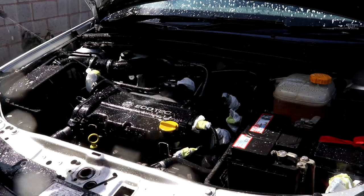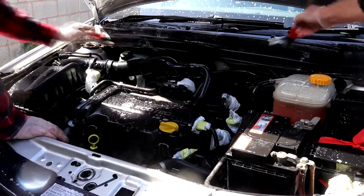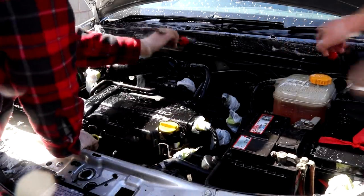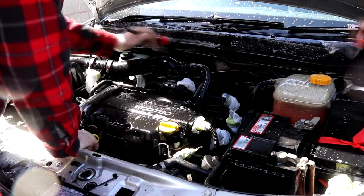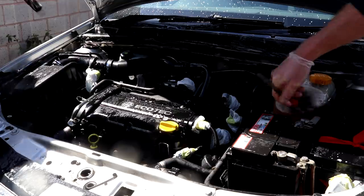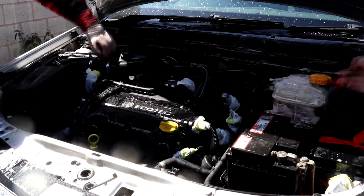When the bay has been thoroughly dosed, get stuck in there with all of your cleaning implements. We begin with those normal looking wheel brushes first, get into all of the top facing surfaces and rubbers, grommets, pipes, tubing, covers and seals, etc. Followed with utilising each of those other brushes and mitts to get into all of the other accessible areas.